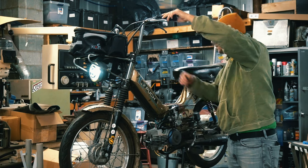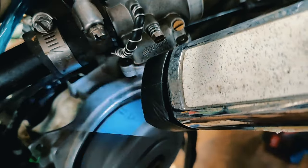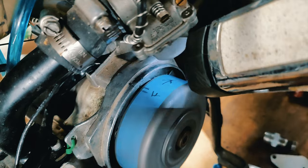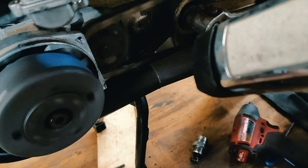I gave all my connections one last check, put the spark plug back in, and it fired up on the first kick. I double-checked that the timing marks are staying on point and revved it up to see if this thing has any curve. As you can see, the timing marks are moving a little bit — I'm guessing three or four degrees of curve — and I'm not revving it all the way to full throttle on the stand because I don't want to do any damage, so that's about 8,000 RPM. That was really easy. Even with filming, it only took me about two hours to get everything working. Then I took a little time to mount the coil bracket in the stock location, put on a longer spark plug wire, and cleaned up the wiring. Now I've got great lights, the CDI looks good, and overall it seems like a nice unit. Time will tell if it stays reliable, but I'll post up on Moped Army with more details and keep everyone posted on how it goes. Thanks for watching.